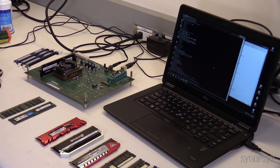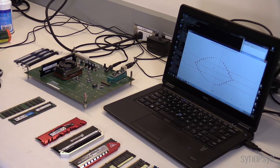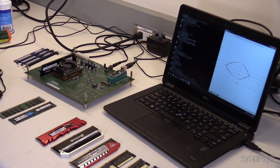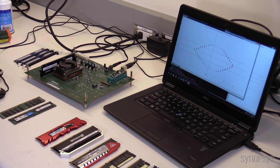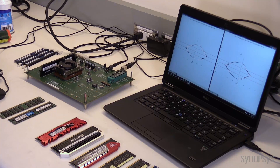He's rated at 2133, so let's run him at 2133. We were successfully able to train. Let's pick up some data eyes and see what they look like. That's beautiful — really beautiful. Now, just for fun, let's see if we can go a little bit higher and push him to 2400. That's overclocking about 10% on this, and still nominal voltage. Still looks great — very nice data.